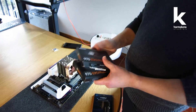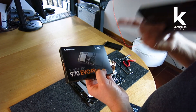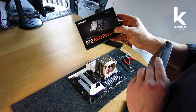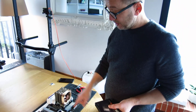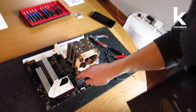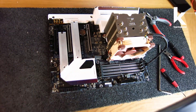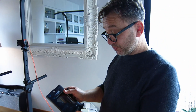Now we install the two hard drives: a 2TB system drive for software, instruments, plugins, and samples, and a smaller one for recording. Both are M.2 drives that go directly onto the motherboard — much faster than SSD, which was faster than ATA, which was faster than SCSI. They go in slots A2 and B2. We also have two 32GB RAM sticks — 64GB total at 3200MHz.